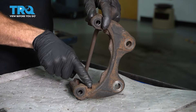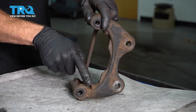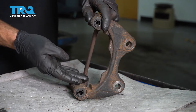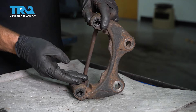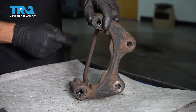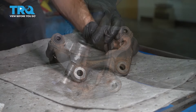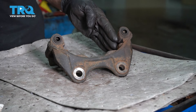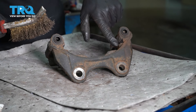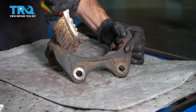The next thing we want to do is clean up the areas where those caliper bracket tins were. You can see this caliper bracket is extremely rusted in this area. By leaving this rust in here, there's a probability that your brand new pads are going to get stuck, shortening the life of your brake pads and causing possible brake problems. Go ahead and sand down this area and inside each of the grooves on all four corners of the bracket.